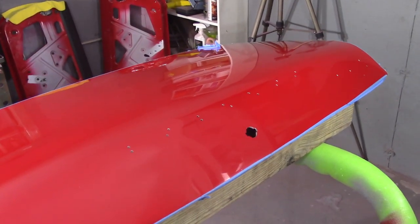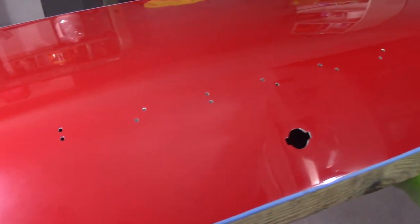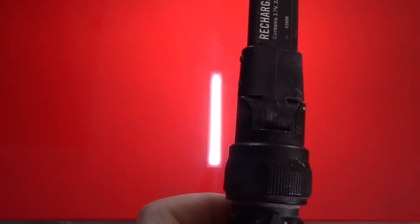With the exception of the door I did a while ago, this is definitely the best panel I've done. There are still little swirls and scratches in it and still some cloudiness around the hinges, but I'm happy with where this is. This is post-yellow pad, so I'm going to do the orange pad and continue on with the next level of buffing, then bring it all the way through the white pad. Still can get better overall - still a matter of spending more time on the grits and removing all the scratches.